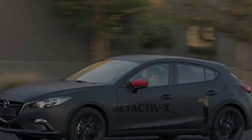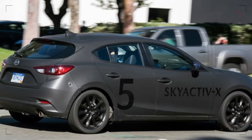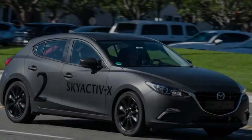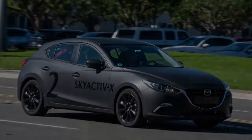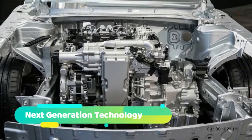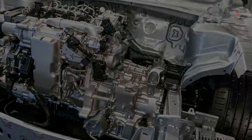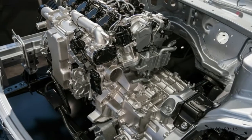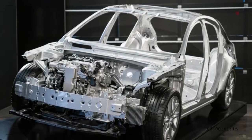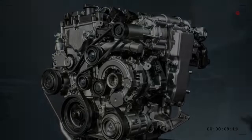That means fewer gears to cycle through when downshifting, less hunting in the automatic, and less complexity. The engine runs around 1,000 more RPM at 60 mph than an equivalent Skyactiv-G, which also offers better response. Pound on it at full load and it'll switch to spark ignition seamlessly. It's only a tablet running on the dashboard that reveals which combustion mode is active, and in normal driving it's almost always in compression ignition mode. Snap off the throttle or back onto it quickly, and there's a loud and obvious rattle — the clearest sign that something unusual is happening. The Mazda engineer riding along explains that these sudden throttle position changes are difficult to tune for, that some pre-ignition occurs in these circumstances where the engine can't react quickly enough, and that the company intends to eliminate these noises entirely for production.